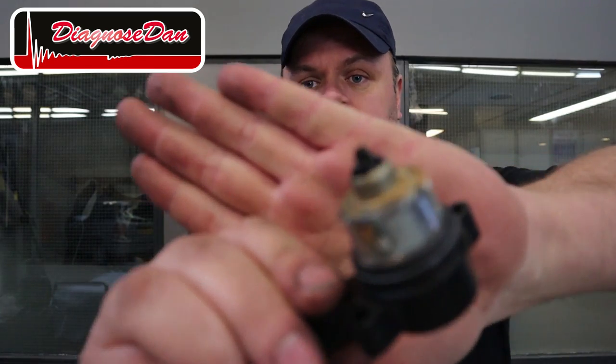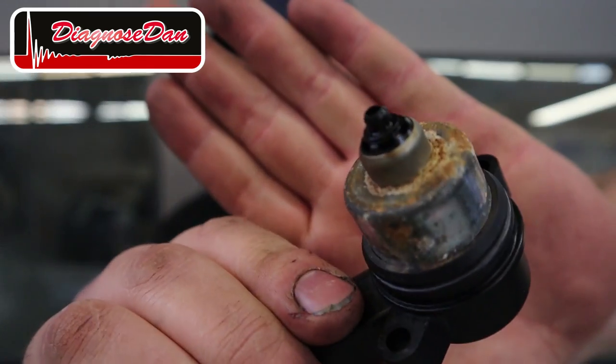Now, depending on where you live, there's a lot of moisture in the air. And moisture can corrode internal parts, like this vent valve. Or take a look at a picture I took of that tiny exhaust valve inside the cylinder head of our compressor. Now, in the next step, I want to energize this solenoid to see if we can free it up again.